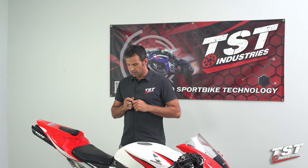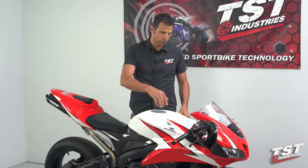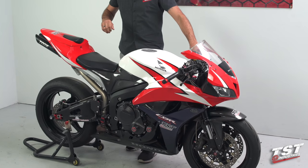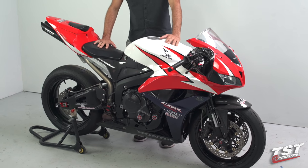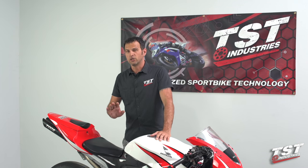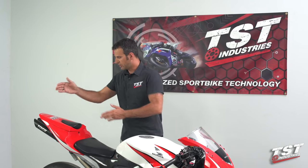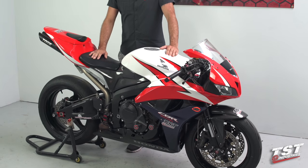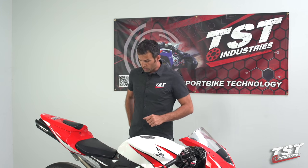In this video we're going to focus on this bike. This bike is very simple — this is one of my favorites to do this mod on. We've changed the OEM signals to aftermarket LED type signals, and we're drawing less current from our signaling system, which results in a faster flash rate. Now you can add resistors in parallel with each one of the signals on your bike, but that's cumbersome, time-consuming, and it's just not a very professional solution.